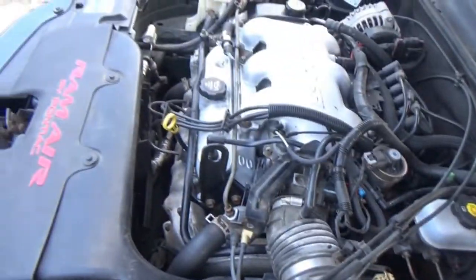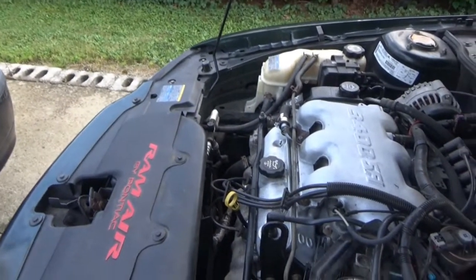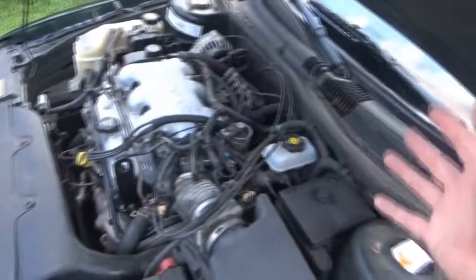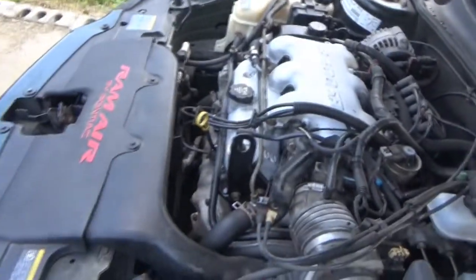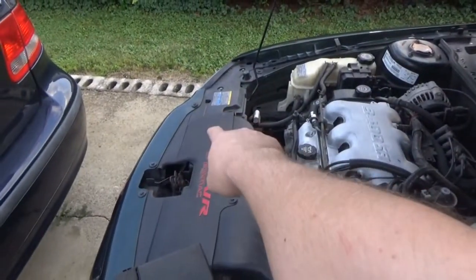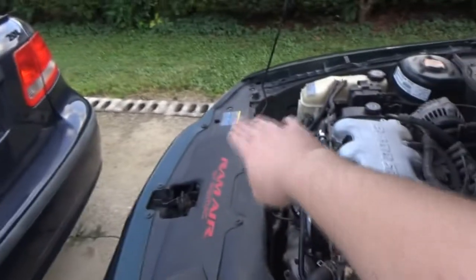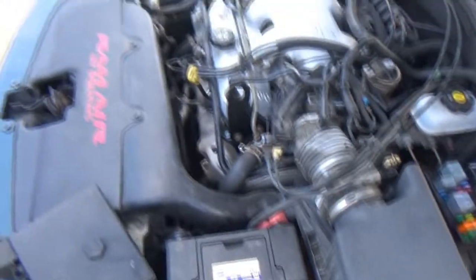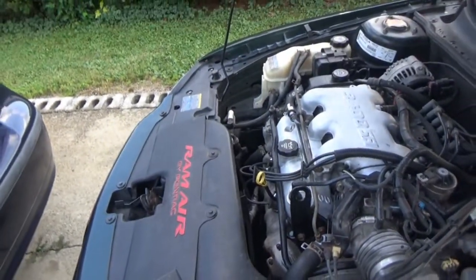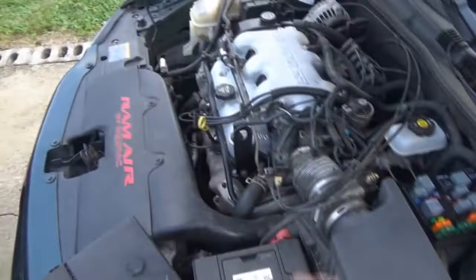But same thing, if you were actually diagnosing a horn issue, from there to there, for maybe an inoperative horn, unhook the horn, push on the horn button with either your ohm meter or voltmeter or a test light hooked up to the correct wiring. There's only power and a ground there. And if your test light lights up, then your circuit is 100% good. You have a bad horn, pretty much.